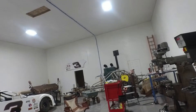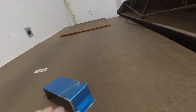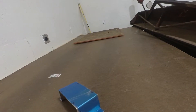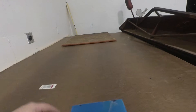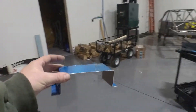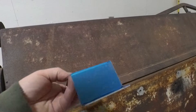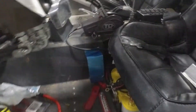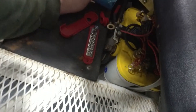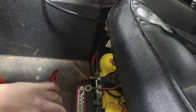We go over to our press brake and bend the metal. Like we said, we took the flat piece, cut it at eleven and a half inches, and marked it with a magic marker — three-quarter inch for the foot, two inches for the rise — on both sides, leaving us with our six-inch base. Once bent, this is what we came up with. Before any cutting or fitting, we mock it up in the buggy, pushing the transmission shifter cable up out of the way to fit it in place.